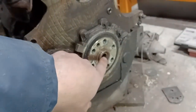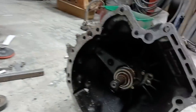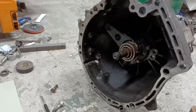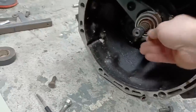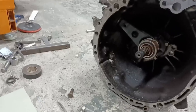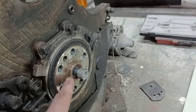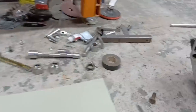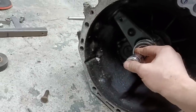The importance of starting with one point — our starting point is the center of our crankshaft. The other center point we need is the center of our gearbox, because those two bits need to be perfectly lined up to each other. The rest of it matters but is not as crucial. You'll see I've already wrapped that up with some insulation tape and tapped a socket underneath, which has the same outside diameter as the crank end.